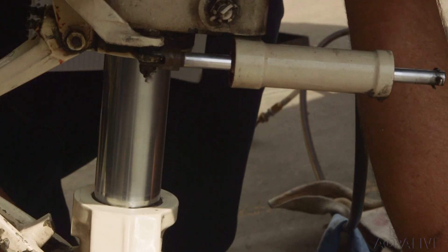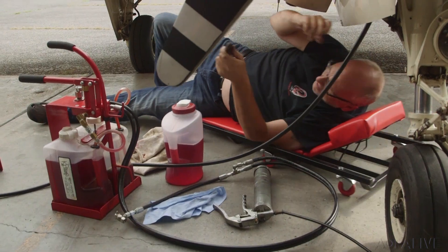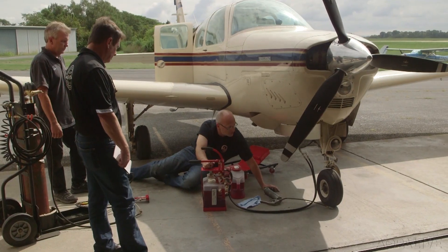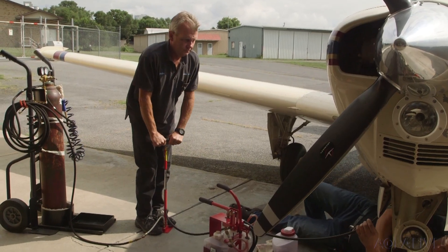And here's some good news — there's now a cheaper, better way to do it. It's cut the labor in half. We can do it in an hour, hour and a half, whereas before it would take up to three hours. He uses an innovative system from Bogart Aviation. Woody Diamond of the Northeast Bonanza Group did the work on my airplane under Andre's supervision. The process is simple: drain the old fluid, flush the strut with some new fluid, then pump in the right amount of fluid and nitrogen.